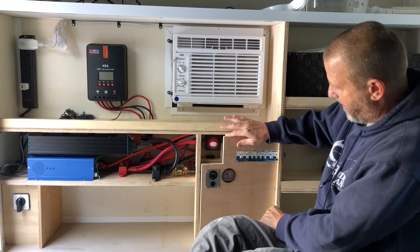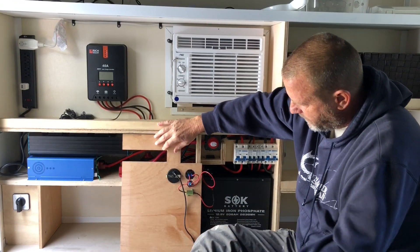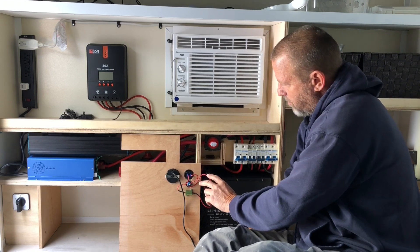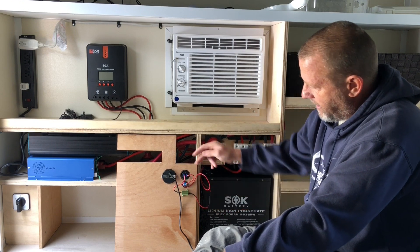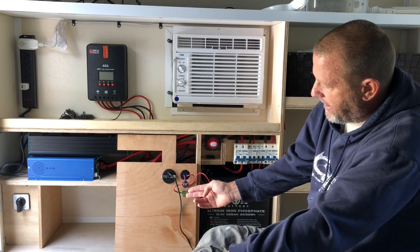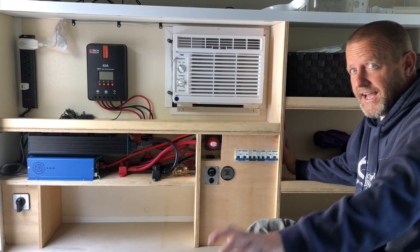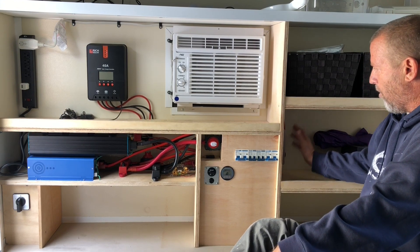Right now you can see back here this is my panel in the battery box. You can see how the pre-charge circuit works. I have a momentary push button switch that closes the circuit across the isolator switch, with one wire connected to the inside and one to the outside. In that circuit I have a 12-volt monitor to read the voltage during pre-charge, and a 25-watt 30-ohm resistor that eliminates the inrush of voltage into those capacitors. Over here on the low-voltage side, I have a 12-space 12-fuse 12-volt fuse box.